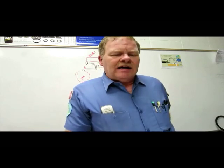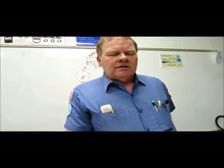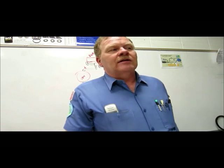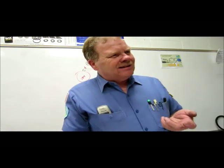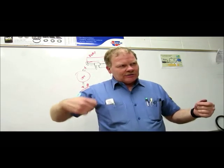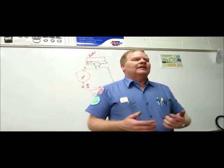The correct location for the pads when hoisting or jacking a vehicle can often be found where? A, near the triangle symbol, B, in the shop manual, C, in the service manual, D, all of these. Okay, let me ask you this. Who looks those up? There's a book out there that we've got. There's actually a hoisting place thing. But I don't know anybody that looks that up. You just look under there. If you've raised a few vehicles on the lift, you kind of know where to put them. But one of the things that people get confused about, like Crown Victorias and stuff, have got a frame and the body's mounted on rubber. And so people get used to only unibody cars, where the frame's made into the body. They want to put it under the place where the jack goes when you're changing a tire. That's fine on those. On the Crown Victoria or some of the pickup trucks, you don't put it under the body of the truck, you put it under the frame. If it's got a frame, you put it under the frame. On the pickups, I like to put it under that round part of the rear spring. So anyway, D, all of the above.